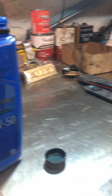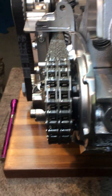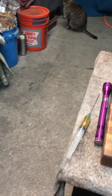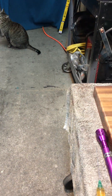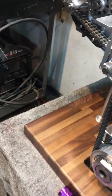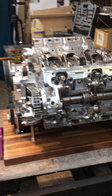Any motor oil will work — these bearings tend to hold oil, and if they have too much they'll drip. If you get a drip down in here, just dab it off with a rag. The nice thing is this base has an oil finish — I use Watco. You wipe it on, let it set for about 15 minutes, and wipe off the excess. You want the oil to soak in rather than sit on the surface, and the more you do that the more beautiful it'll look. If we do leak oil, it's not a problem because we have an oil finish. Thanks for your time and I hope you enjoy your new creation.